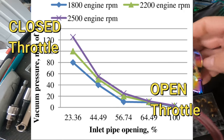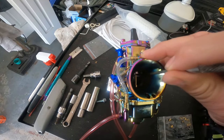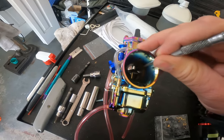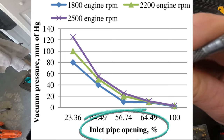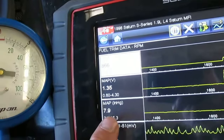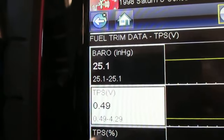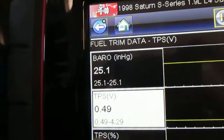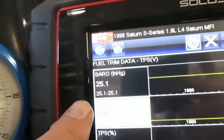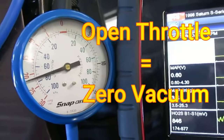The reason we say that is because high RPMs usually come from opening a throttle, and it's actually throttle position that's making us create less vacuum. As you open the throttle, here's your vacuum with the throttle closed. As I open this throttle up, the outside air is allowed to go into that intake manifold, and so the manifold pressure equalizes with the pressure of the air we're breathing — and that is not a vacuum. We end up losing our vacuum with throttle opening, not with RPM. This is in inches of vacuum, just like this vacuum gauge. Go ahead and just floor it to show that — that's not effective. Floored again — vacuum when I floor it goes to zero, as it should.